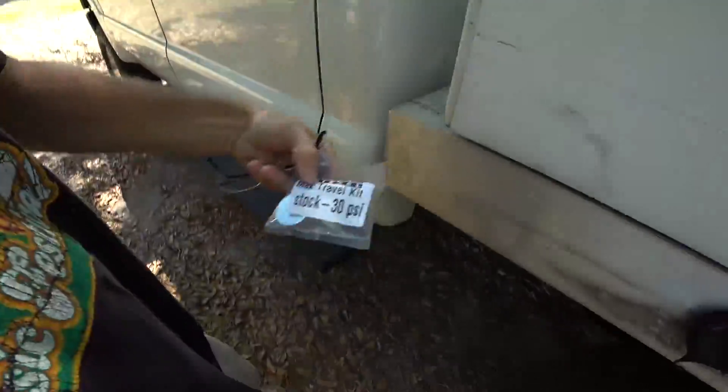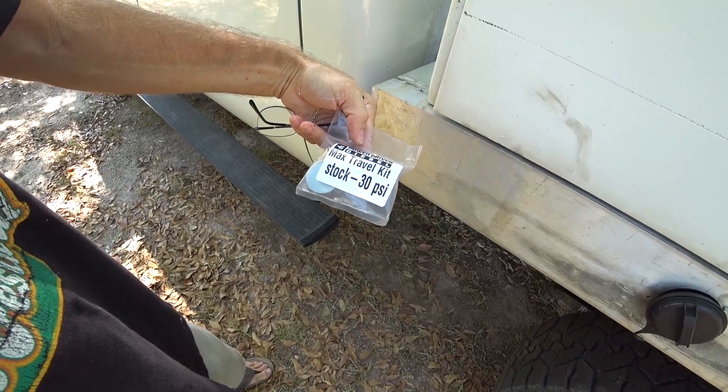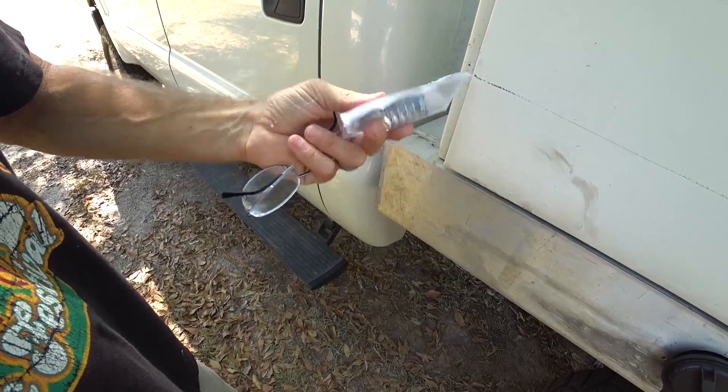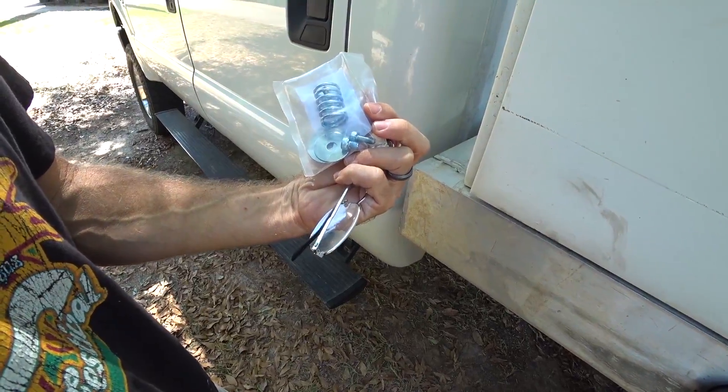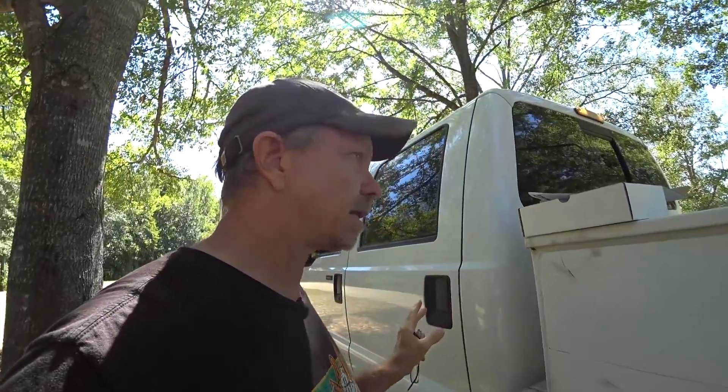It's kind of a pain - I have to stop the truck and restart it to get full boost out of it again. I got the stock to 30 psi max travel kit. Once I turn in my injectors - I've got some 5x12 injectors to put on here - I don't want to do that now. I want to keep the stock injectors in there and see what kind of results I get, and after I'm satisfied I'll go change the injectors up.